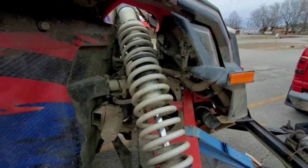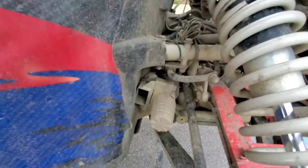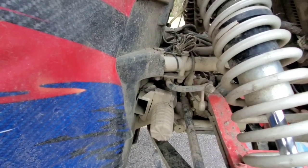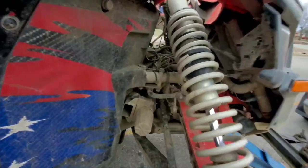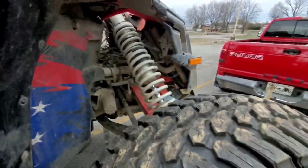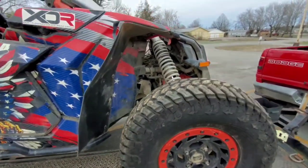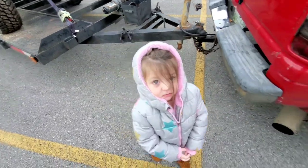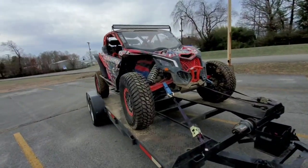Pretty sure the diff has said goodbye. Another thing I want them to check out is the steering rack. It didn't quit working but it's got a lot of slop in it — when you turn left to right it doesn't steer as quickly as it has, and if you get up to a higher speed it'll actually get the speed wobbles. I'm going to get these guys to check it out and also get the first service done — it just hit 100 hours, and the recommended service is 100 hours or 1,000 miles with no break-in service.